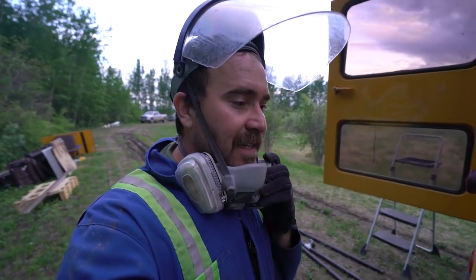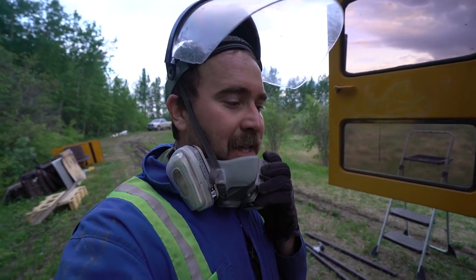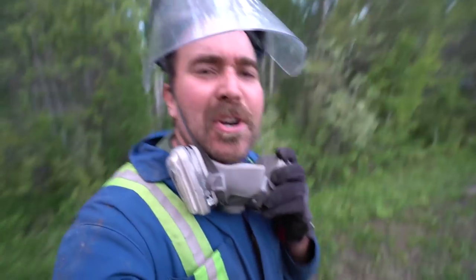Just want to show you guys what it looks like underneath the bus. It's coated with kind of a rust-preventative type thing, but it catches on fire when you're welding. So just watch out if you do this — see that, that's a pretty big flame. It smells like burning tar down there.